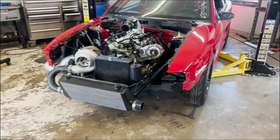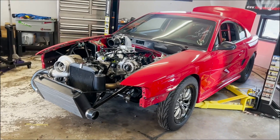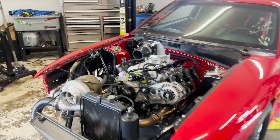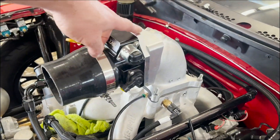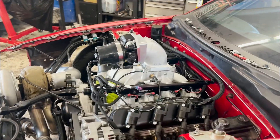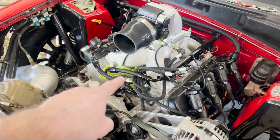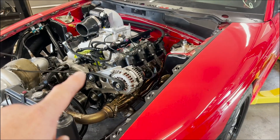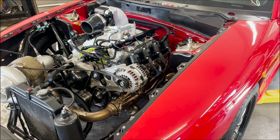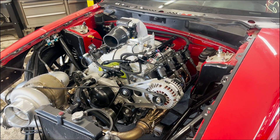I went ahead and test-fit the hood — the throttle body does hit the hood. So we're going to have to flip it upside down, which is fine because I need to put gaskets and sealer on the elbow anyway. There's an adapter here for the Wilson's elbow to use this style of throttle body. Also got a couple little fuel leaks — return line's leaking. I noticed last night the fuel pressure's really high. I rescaled the sensor and started it up again and it's still as low as it'll go — like 60 to 65 pounds.